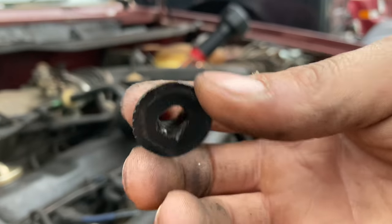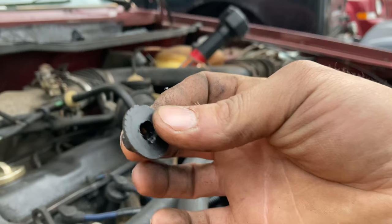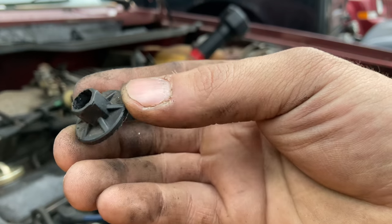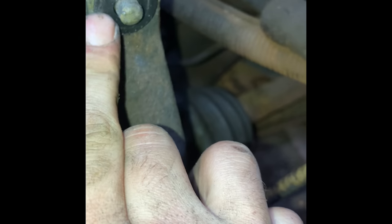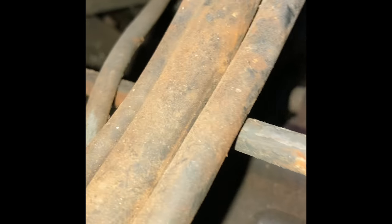What I did was get this piece right here — I drilled a hole through it the same size as the rod. I'm going to put that through the linkage bar, put the rod through the other side, put a washer and the cotter pin, and that should tighten it up real good. It's beveled on this side a little bit so it doesn't allow it to move a lot — it's going to be nice and tight. What I ended up doing was using two pieces: that plastic piece in the front and a rubber washer in the back. Now it's nice and tight. It's going to be a little tight to get the cotter pin on there, but then we'll also address the other shift linkage down there that's a little wobbly.